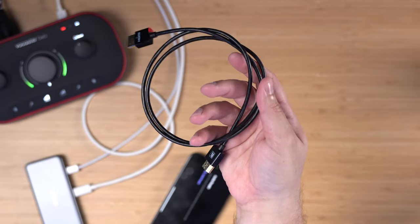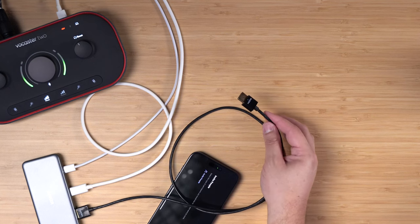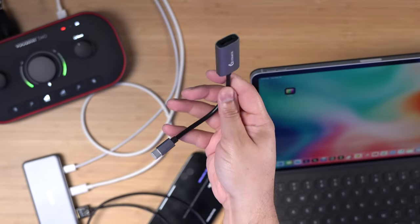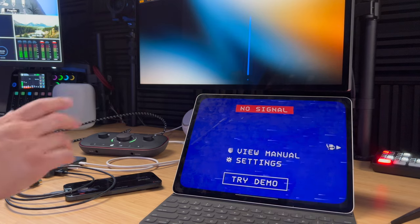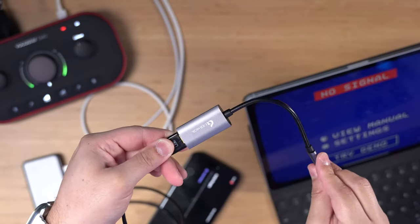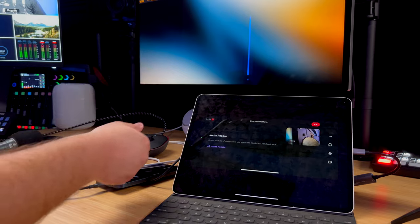Finally, let's say you want to use the back camera on your iPhone because that's the best quality video, but you still need to see your remote guests so you can't have your phone turned around. The new iPhone 15 actually solves that too. Using the same USB-C hub, which has an HDMI out, I can connect an HDMI cable. You can plug the other end into any external display and it will mirror the iPhone so you can see your guests. If you don't have an external display but you do have an iPad with USB-C, you can get an inexpensive video capture device — it's about $20 on Amazon, we'll put the link in the video description — and use it to mirror your iPhone display to an iPad. On the iPad you'll want to use Orion, which is a free app. I'm going to plug the other end of the HDMI cable into this adapter and then plug the adapter into the iPad. Once it's plugged in, it's now mirroring my iPhone screen onto the iPad, which means I can see my remote guests here and still use the rear camera on my phone.